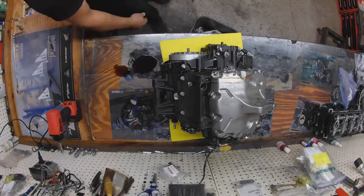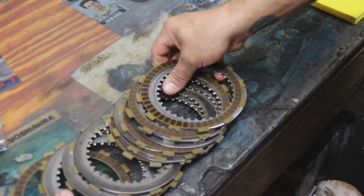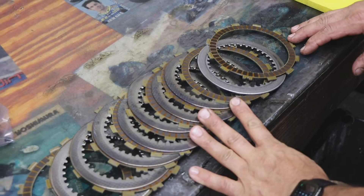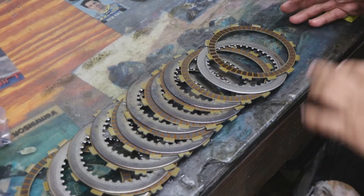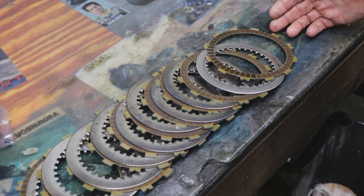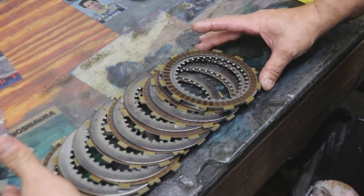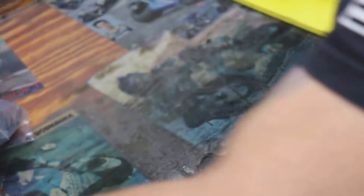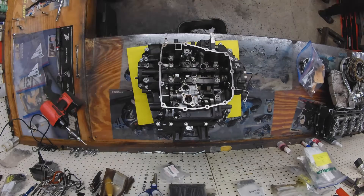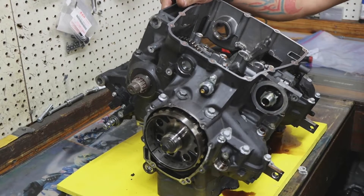We took the clutch out. As you said, this is the only clutch you ran all year — the only clutch we ran for 4,000 race miles. Which is great. It's dark, but it's not burnt. It wasn't really putting any deposits in the oil. It was going to get replaced regardless. This is where you want to get it before it gets really bad and starts potentially causing problems. We know we can go 4,000 miles safely. That you can run 4,000 miles of race miles is insane. I think a lot of that has to do with how well the race electronics, the quick shifter and auto blip work with the style of clutch in this. You could put a different clutch in that slips more, but it's going to put more wear and tear on the clutch.